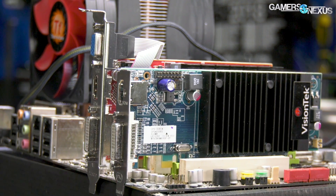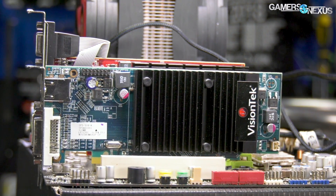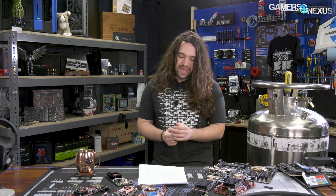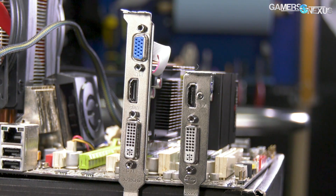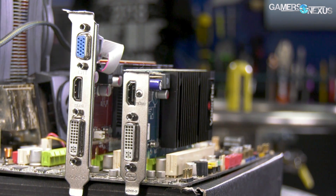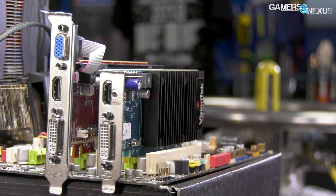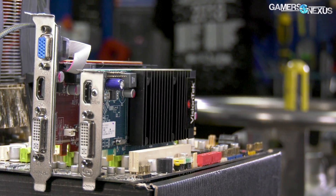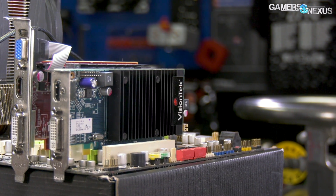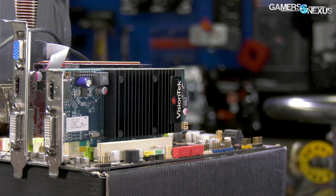Although we're mostly scoring to see who got the better mystery box, we did have to work together on some tests. For CrossFire, we used the 5450s with higher overclocking capabilities just to get a number on the chart with some chance of a reasonable frame rate. The CrossFire overclock used for testing was 700 MHz core clock (up from ~650 MHz) and 725 MHz memory (up from 500 MHz). The lower-capacity 512 MB 5450 managed a memory clock of 900 MHz without any visible artifacting, all done through AMD's control panel.